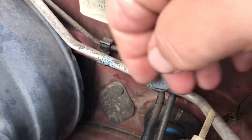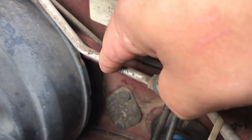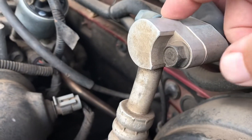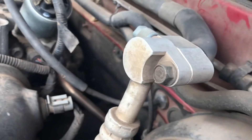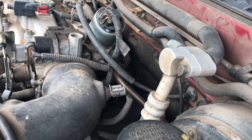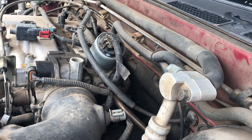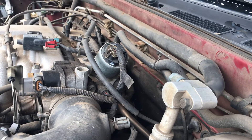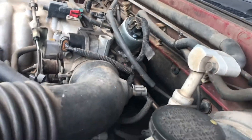Find your AC fittings — they're quick connect fittings. This one indicates it's high pressure because it's got an H on it. Typically it's the smaller line, so you can tell if it's high or low pressure that way. The larger line is the low pressure line. Always find those first because that's what you're going to hook up to. I'm going to get this manifold set hung up where you can see it and show you how the pump works.